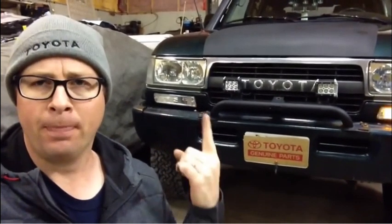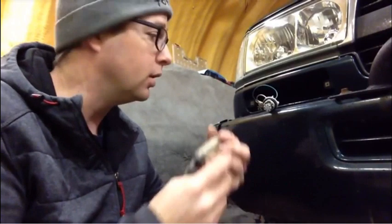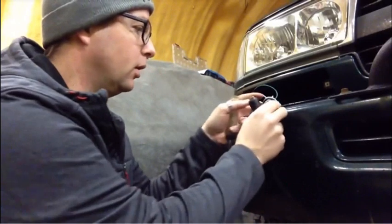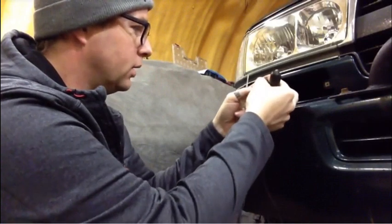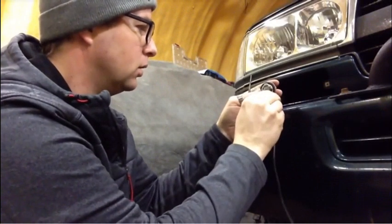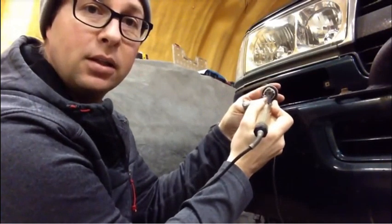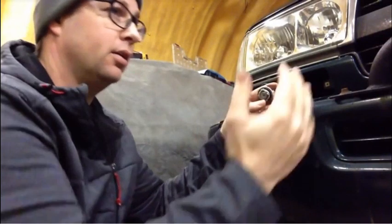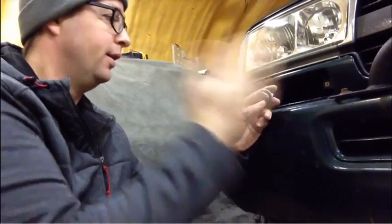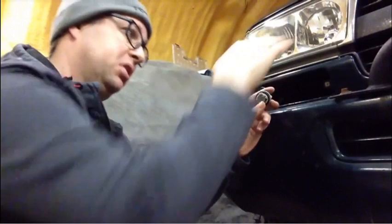Next up, I'm going to remove this bulb socket housing and see what I get on the back of that. Using my test light — a simple replacement for the bulb — I'm going to make sure the circuit isn't working by taking the bulb out and replacing it with something else. So out comes the bulb. All I need to do is contact my test light from the outside to the center. That's on the outside, that's on the center — and my test light's not flashing. So at this point it's not likely the bulb. I've now narrowed it down to something on the front of the truck, this side of the truck, and it's not the bulb — it's between the bulb and somewhere in the truck.